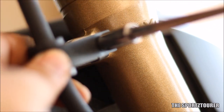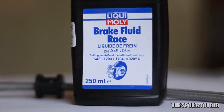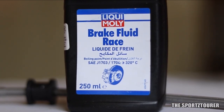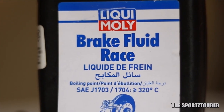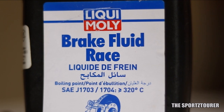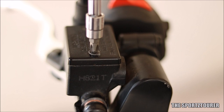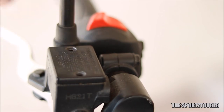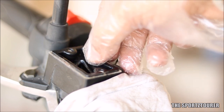So I had to install back the rubber brake line, and my last hope was now on the race brake fluid. If you go online and search, you will find a lot of good stuff about the Liqui Moly race brake fluid. I got this one because it is one of the most affordable race brake fluids available, with a dry boiling point around 320 degrees Celsius — way above the standard DOT4 brake fluid's boiling point of 230 degrees Celsius. I did make a detailed video covering brake bleeding, link for which can be found in the description. Coming back to the performance of the race brake fluid, surprisingly, it did make a difference even with the rubber brake hose.